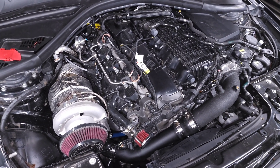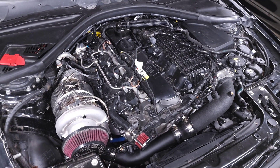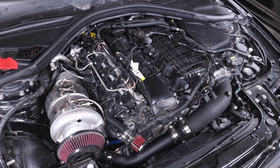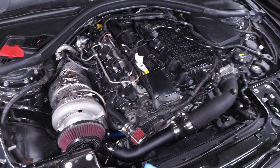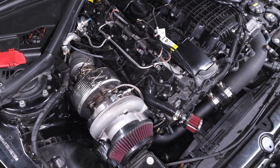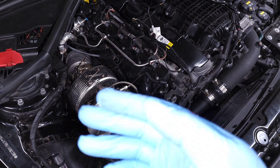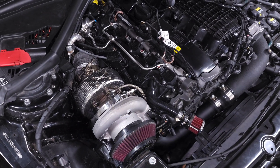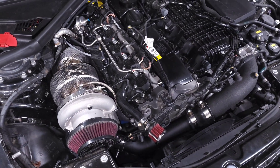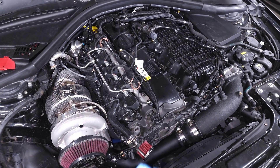There are a couple different ways to do this, so I'll cover the different things that I've done or other people have done to help make this process work. Basically the whole goal is to get some oil in your turbo before you actually turn your engine on. When you get a brand new turbo it's completely dry, and you really want some oil in the center housing so that when the car is turned on and the wheel speed ramps up to an incredibly high RPM, it's properly lubricated — otherwise you can experience a lot of excessive wear and potentially an early failure.